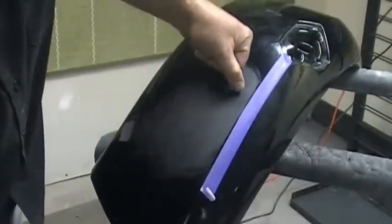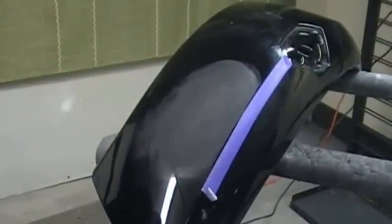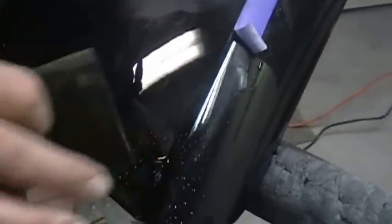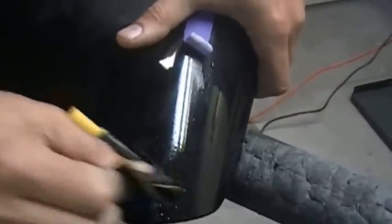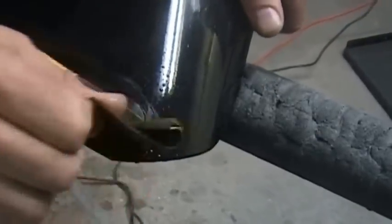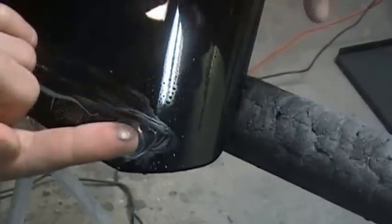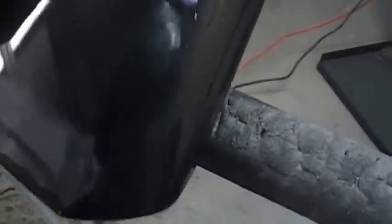In the right light, just barely, I can still see a little bit of that scratch, but at this point I am not going to worry about it. One thing I will show you — in my other video I showed you how to burn the paint. So this spot right here is burned. If you can see that water right here, it is kind of grayish — that is because I am into the black paint underneath. When you see it go from that white to that black, that means we have screwed up. That means I hit the paint underneath. Once you do that, there is nothing you can do. You took the clear coat off — the shine won't be right, nothing will be right.